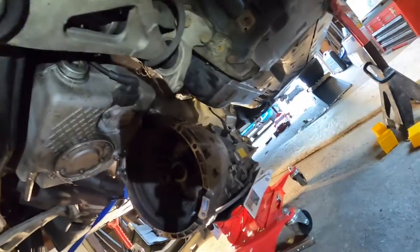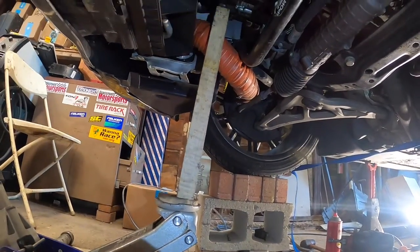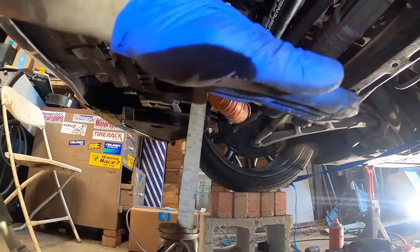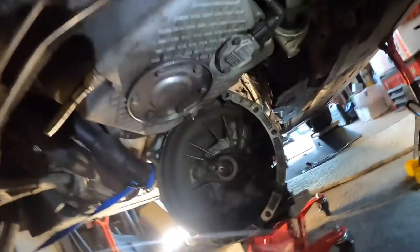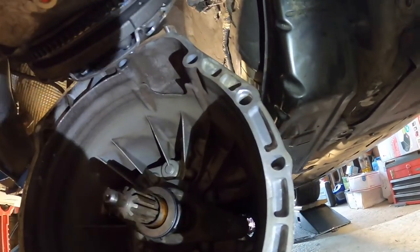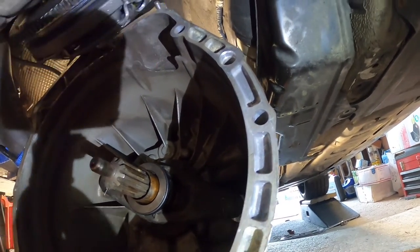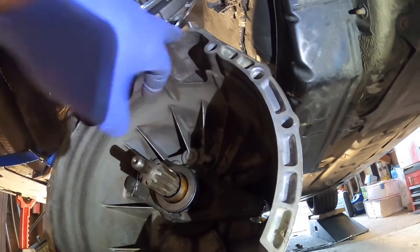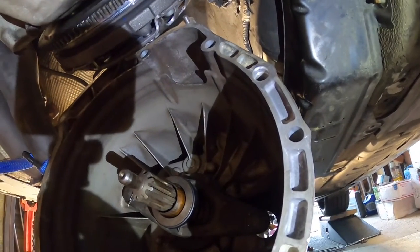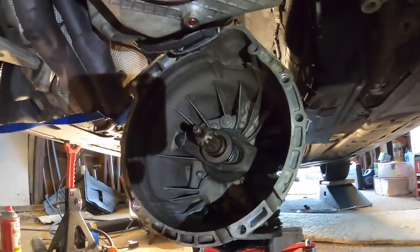So before you put the transmission back in, what I did is lift the engine, supported it at the AC mount, and lifted it so it's tilted backwards like this, so it's easier to slide the transmission in. So that makes things a lot easier. And then I don't know if I mentioned before, you want to file this pin down so the starter goes on nice and smoothly without any issue, because we had an issue removing it. So I used some coarse, like 36 grit sandpaper, and took off some material. You got your bearing installed, so we're ready to lift this back up.